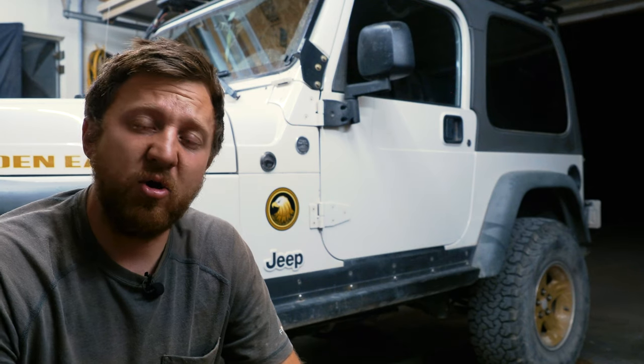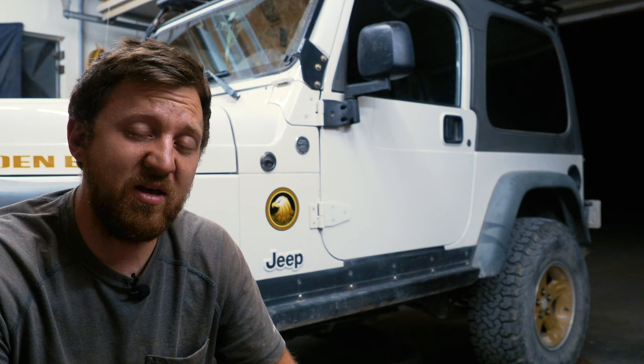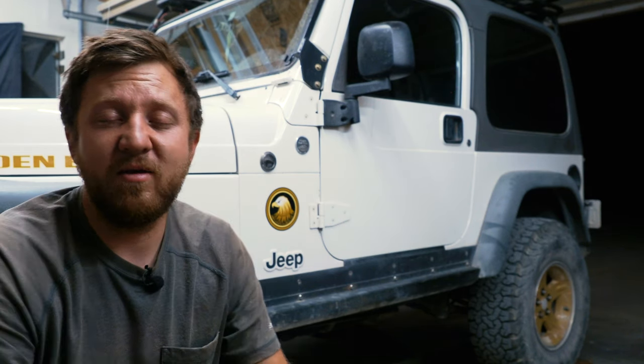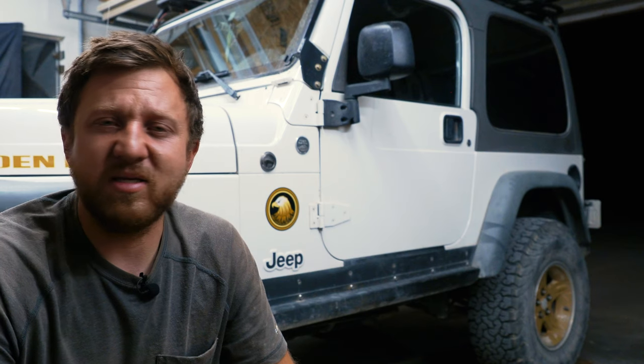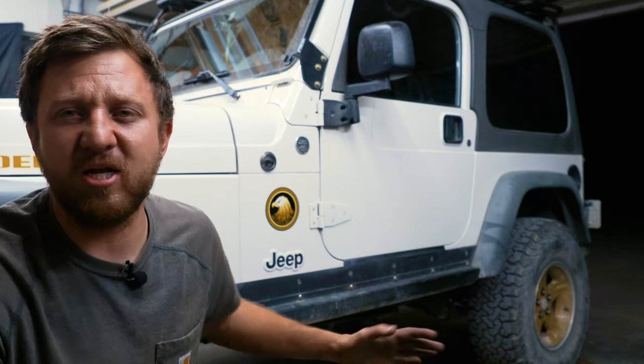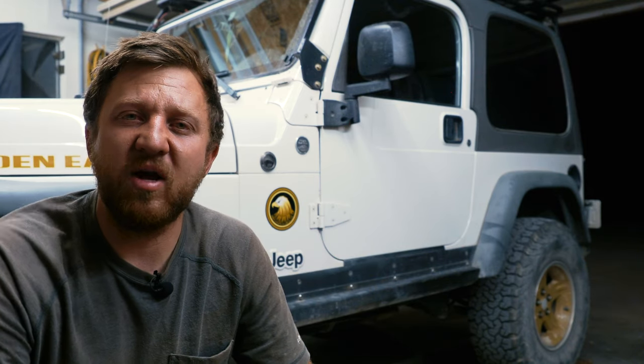With the body lift, we're going to do a motor mount lift. And then from there, we're going to decide whether we do a tummy tuck or not. And what it's going to come down to on the tummy tuck is what's my rear drive angle going to look like. If it's going to look fine, then I'll do the tummy tuck. If it's going to look iffy, then I'm not going to do the tummy tuck. Or the belly up skid is what I mean by saying that. Only because I want to keep those driveline angles really nice. And I can handle just an upgraded skid plate down there and handle a little lower to the ground. We're good enough at driving for what we do.